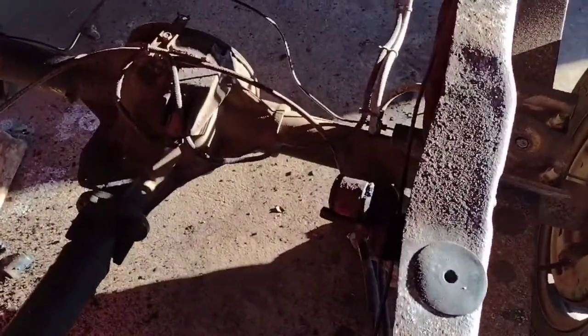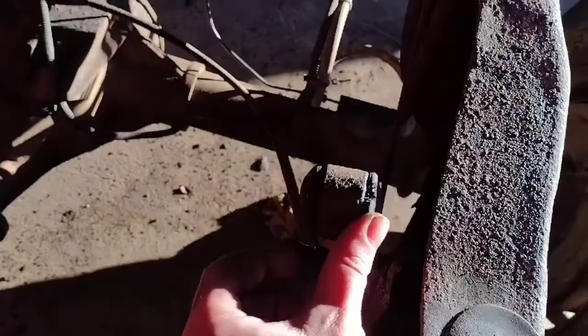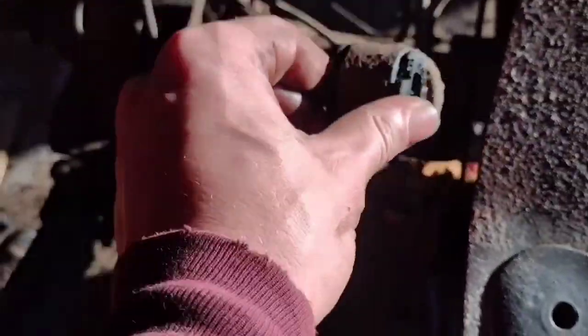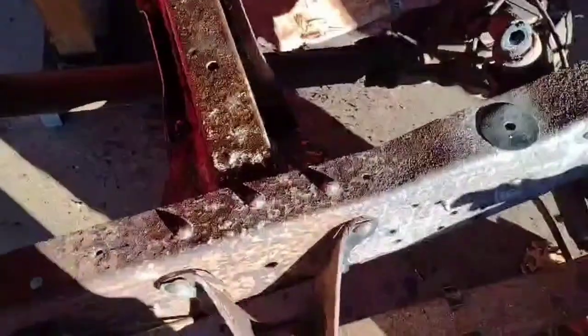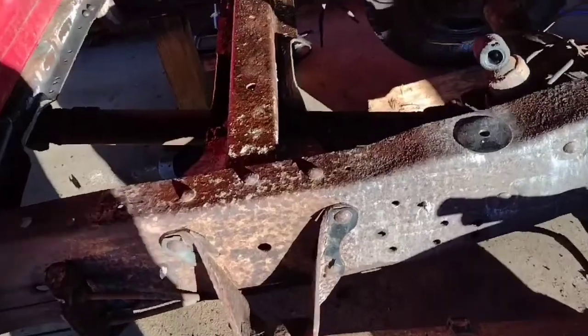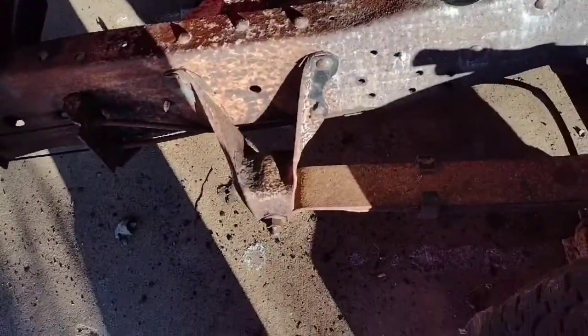Alright guys, so I've been kind of bouncing around here. I did go ahead and take this other shock over here off. This nut on this side was an 18 millimeter. So I think the one on the other side was just really worn, rusted out bad. 18 millimeters on both of the bottom nuts that hold this in as well. So I'm about to take this shock off. I'm not going to put the shocks back on yet until after I get all my brackets replaced and things. Then I'm going to put the shocks on, fully load it, and of course tighten my big bolts down.